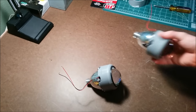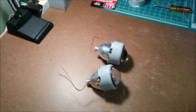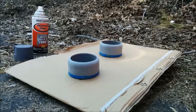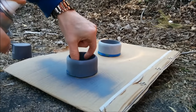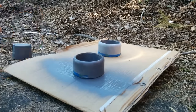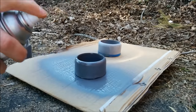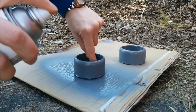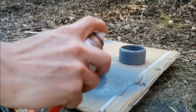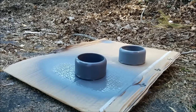After I was done making one shroud I made a second one with the same process. Now I wanted these to pop inside the headlights so I decided to paint them red to match the color of the car. I used high-temp primer and high-temp paint because I was planning on using HID projector lights, and those can get pretty hot. I didn't want anything failing on me or paint peeling later after I had everything sealed up.